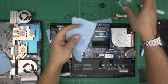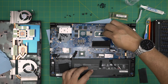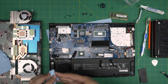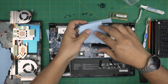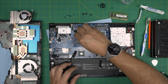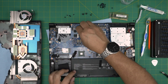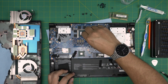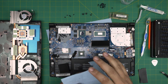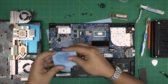To clean the heatsink and CPU, grab one sheet of workshop towel, soak it in alcohol, and rub over the CPU to remove the excess thermal paste. Use another pass for the GPU. Put plenty of alcohol on the towel — as you can see, the towel may get caught around capacitors but it will not damage them. Use a dry part of the towel to rub over the crystal die until it's clean, then clean the GPU and the heatsink the same way.